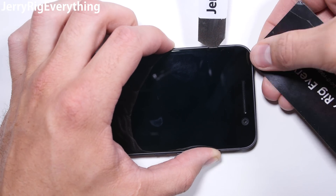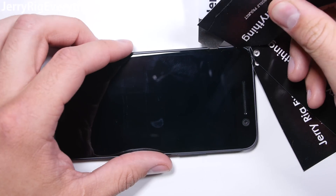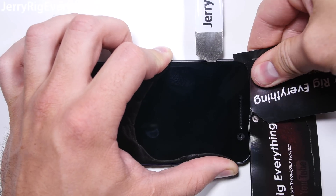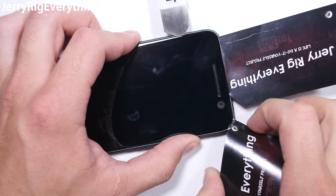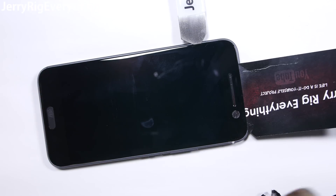you don't need to be as careful as I am, but I want to keep using my phone since it's in good condition. If you put your playing card in too deep, it will damage the super fragile LCD. Basically, if you're going to open your phone for something other than a screen replacement, just plan on replacing the screen as well. It's that fragile.